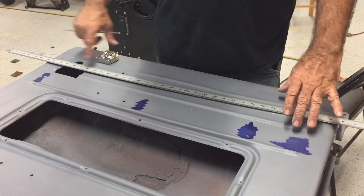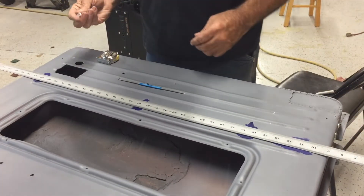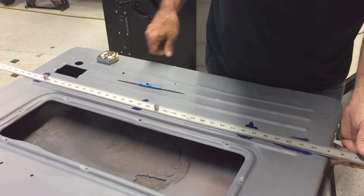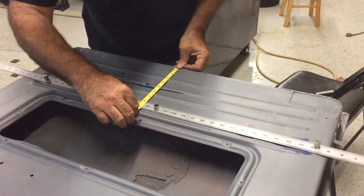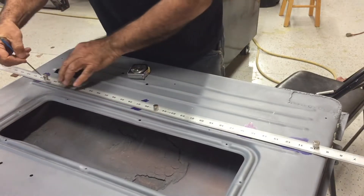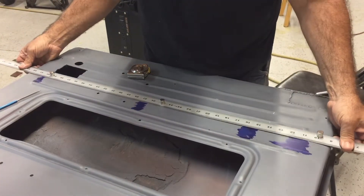I have this really thin flexible 48-inch straight edge, and I've got these neodymium magnets — watch your fingers with those things — they'll hold it in place right there. I put Dykem layout fluid on here; it makes it easier to see. Using a sharp scribe, I get a good mark at 9-3/16 inches, and then I'm also going to do it at 8 inches.